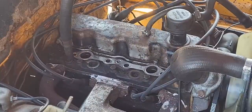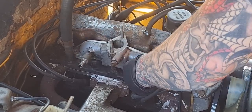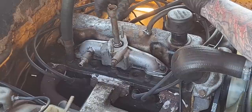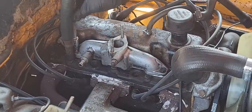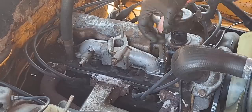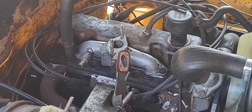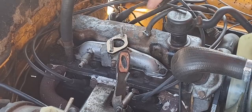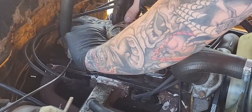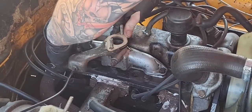Putting a brand new metal gasket on there before I put the intake manifold back on. And as you know, tighten it back up with three half-inch bolts. Want to replace all the gaskets here and everything to eliminate any sort of air leak. Putting on a brand new insulator spacer block, Weber one, which has got the gaskets already on both sides. And the accelerator bracket goes back on with a brand new gasket on top of that.